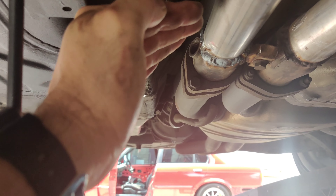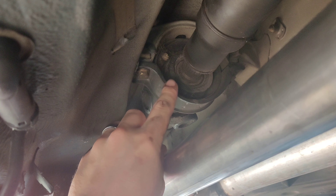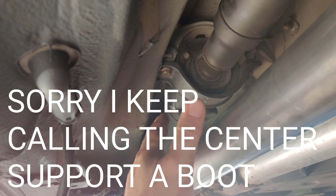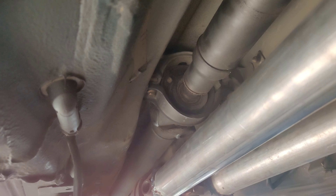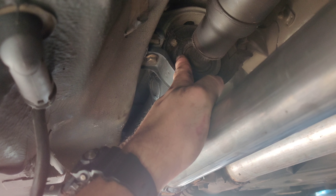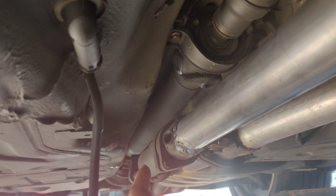There was just one small issue we're going to look at today — it might not be a small issue but it's definitely fixable. We were getting this crazy noise during heavy acceleration or heavy braking and couldn't figure out where it was coming from. Xavier swore it was coming from the drive shaft and I told him there's a great possibility, but let's drive it up and down the road — it could be a wheel bearing, a differential, all sorts of things. We'd already put it up in the air and tried to move the rear wheels around and couldn't find anything, so we went to the next step of just driving it and having one of us stand outside. We finally said it's probably going to be exactly what we thought: the drive shaft bearing support either breaks off or the bearing goes bad, and you get some weird noises, sometimes some clunking, right in the middle — and that's where we diagnosed it.